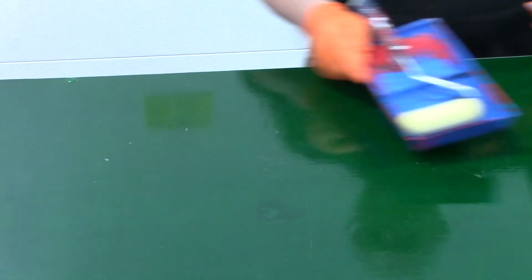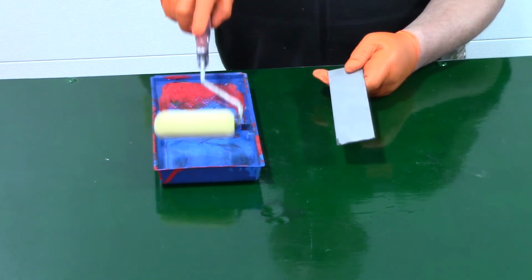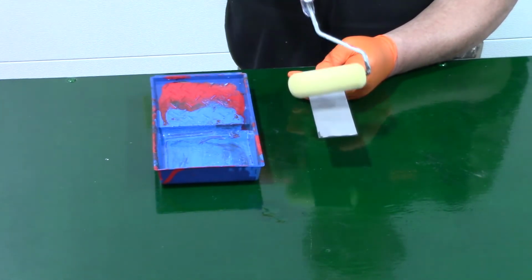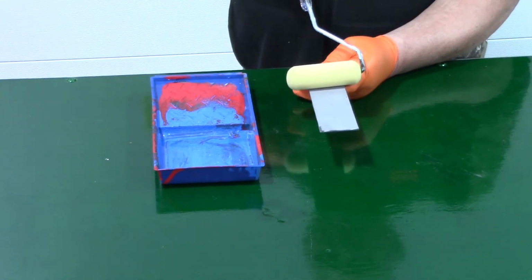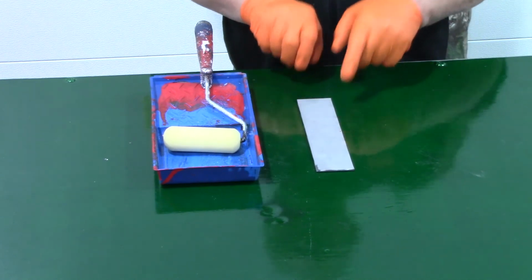If you're using a roller, use a foam type with a 3/8 inch nap. Again, apply 2 light coats, maintain a wet edge, and stretch the paint in one direction so there's a uniform appearing paint film. Don't overwork the roller. Again, allow the primer a minimum of 8 hours to dry between coats.